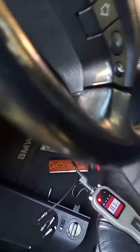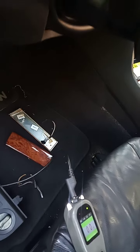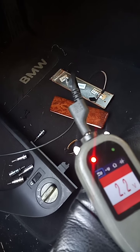The one below, with ignition on, we should have 12 volts. Let's put the ignition on — there we go. Then on the black one, when we turn this switch, we should have about 5 to 10 volts.